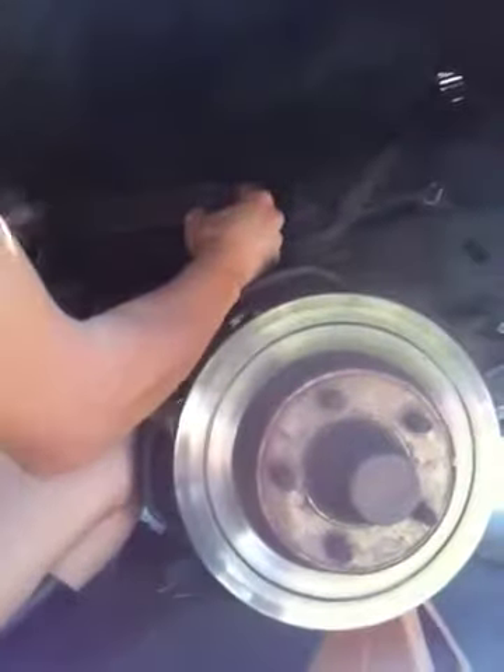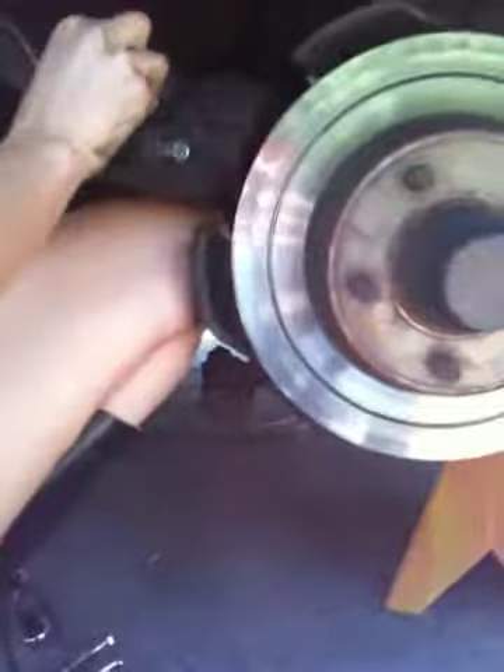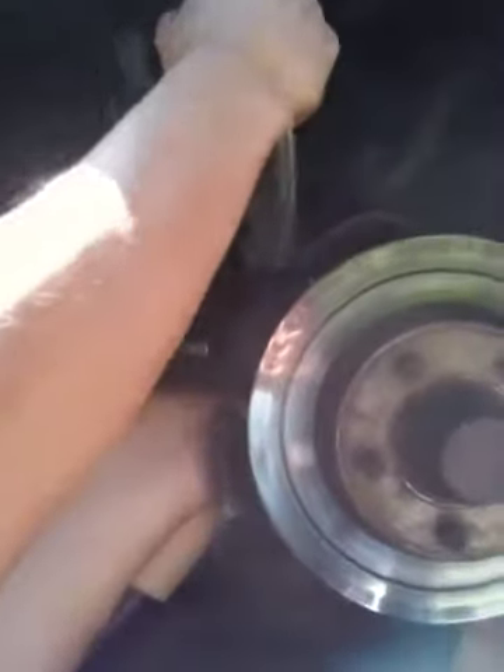So here's a tip — you get one of your old brake pads and place it on the piston. I put it there so that the clamp won't collapse directly into the hole of the piston. That makes it much easier to compress.